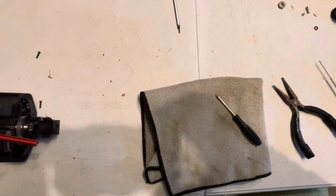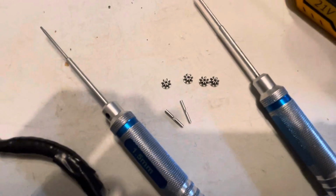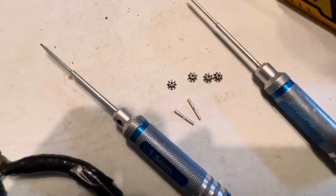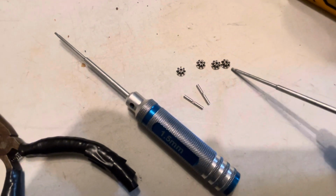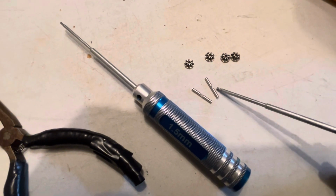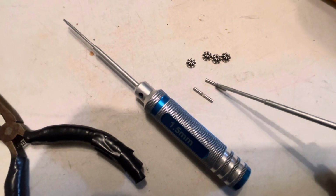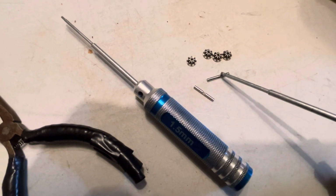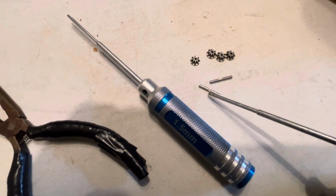And let me take you off of here and just move you around and show you. There's the spider gears. Another thing I found when I was taking off the spider gears, these are the spider gears here. The pins that hold the spider gears are bent. They're bent. So those are garbage. I'm not going to even try to bend them back, but those are bent.